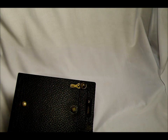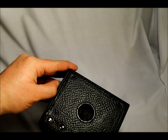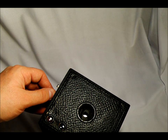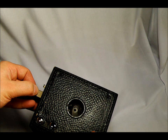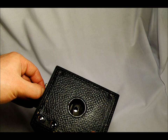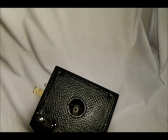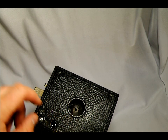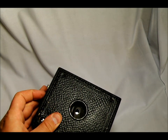As I mentioned, it has this aperture. I'm going to set this to time again. The way you're actually supposed to do it is pull that lever up. You can see inside — you can see the lens — and as I pull the lever up, increasingly smaller holes move in front of the lens. So this actually has three aperture settings. Because it has a single shutter speed, the only way to control your exposure is to adjust the aperture. The smallest aperture is F22, then F16, then F8.